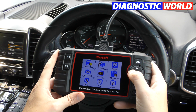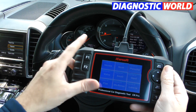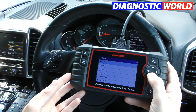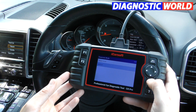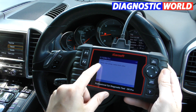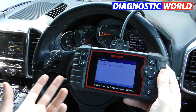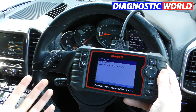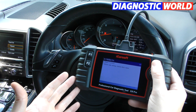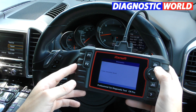What does it give with regards to fault codes? We've got an airbag warning light on this car — we triggered this manually ourselves just to show you this tool diagnosing and resetting that fault. Clicking into Porsche and into the airbag system, it gives us a unique fault code and a description. If it doesn't mean much to you, put the information into Google — lots of forum information exists about what these codes mean and how others have fixed the problem. We click enter and we get rid of that airbag light — it's as simple as that.